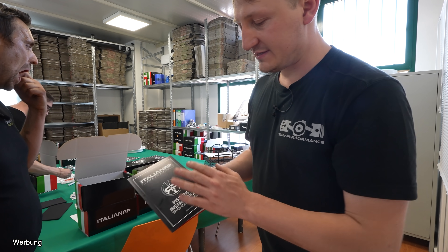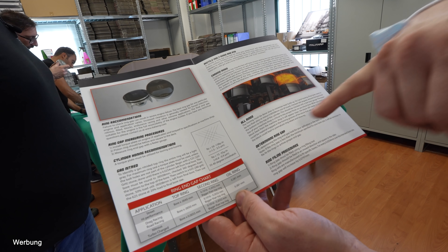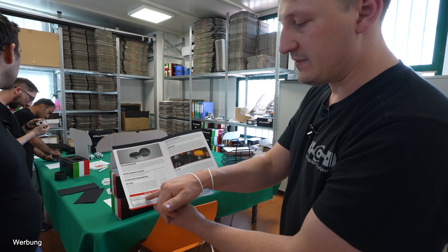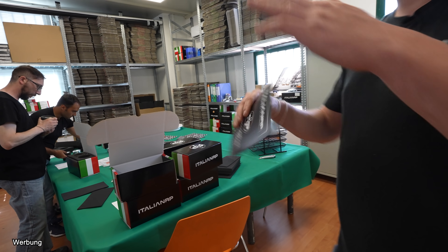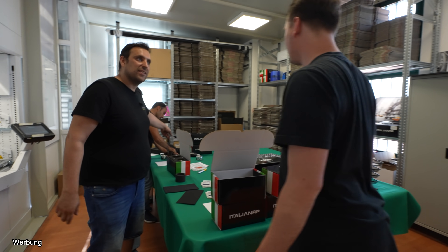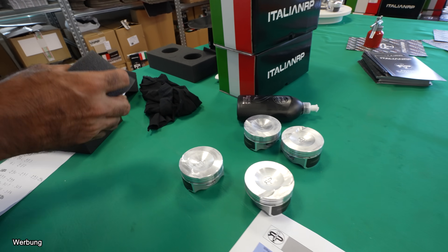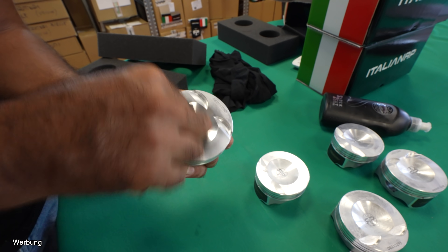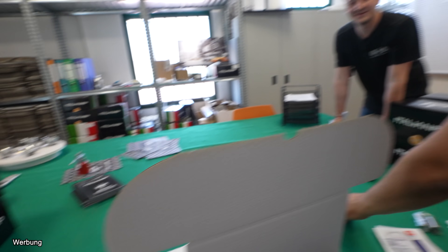In summary: we have here the installation sheet and he gives the Rz and Ra measurements — the surface roughness of the cylinder walls, the honing angle he wants, and the exact gap measurements for the piston rings. Everything is taken care of. I find this complete product simply convincing. You can see here — is he polishing? Yes, all pistons get a small polishing. Silver line also? Yes, all pistons. Only then it looks like jewels — it is important, yes. When it's ready, it goes down with the conveyor.